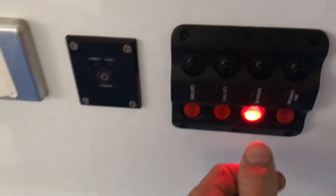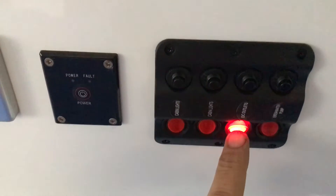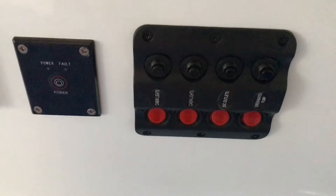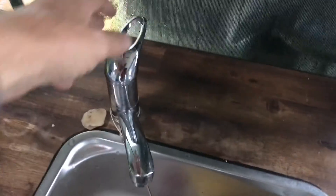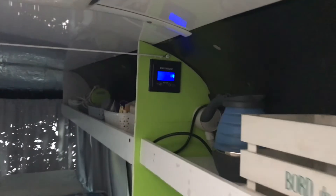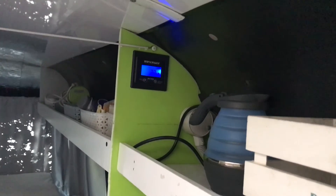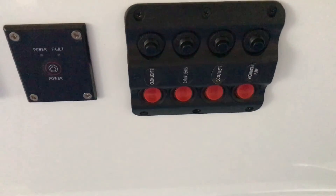With all these switches, I ask you to always turn them off — that's better for 12 volt, because you only have batteries, and the less it's on the better. The pump — water pump — turn it on there. Over to the kitchen. Pump's away, and you see the meter up the top there too. That comes on automatically. When that light goes off, then it's safe to come back over here and turn the switch off. That's it for that power board.